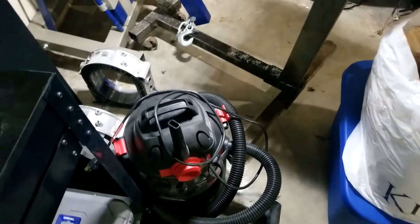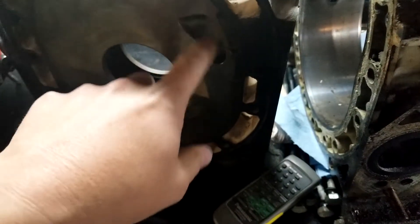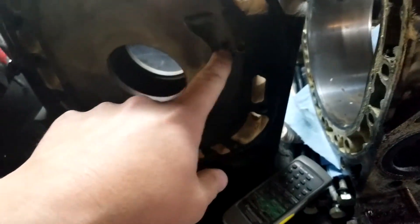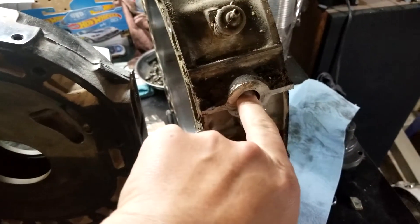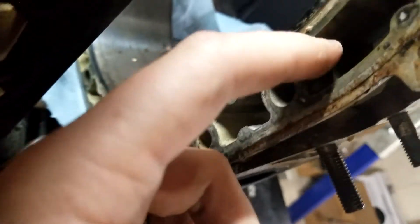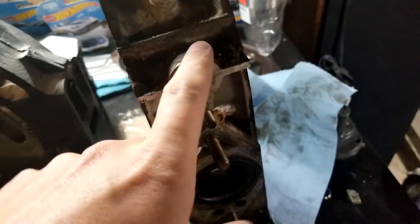There's also something called a semi-peripheral port. I don't have one of those, but it's essentially the same thing as a peripheral port, minus the fact that it's significantly smaller. On a semi-P port motor you still retain some of the stock intake runners — you might keep the center housing or side housing runners, or block either off. On the semi-port, you drill this out and sleeve it so that coolant doesn't pass into it, and essentially allow air in that way. That's a semi-P, and those are pretty fairly common.